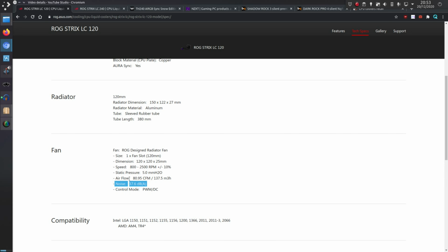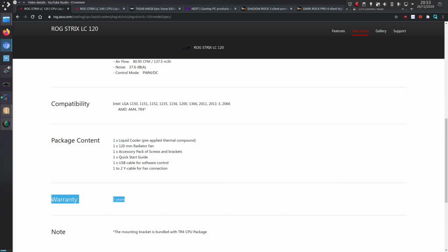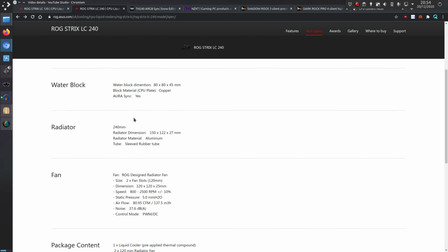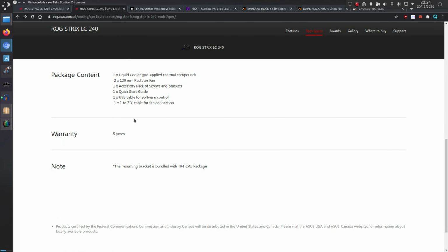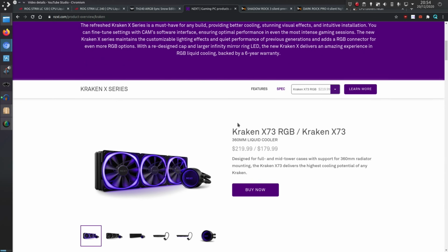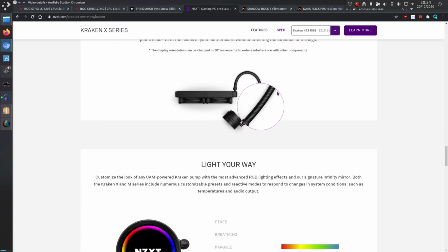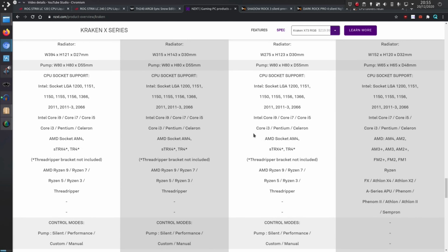Although you can get dual fans, and I've had those in the past. But it was difficult to say really, because a lot of these coolers I was looking at didn't actually say the performance on them. How much heat could they actually dissipate away from the CPU? Because let's say that was 120 watts that could dissipate and the CPU is running at 100 watts, then you've got that 20 watt margin, so you're going to be running fairly high speed if the CPU is actually getting hot after a period of time. But if it was higher, let's say 150 or 200 watts, then at worst case you're going to get about half speed out of it, so that's going to remain very quiet.